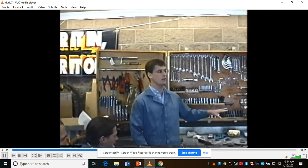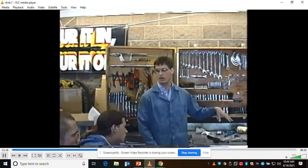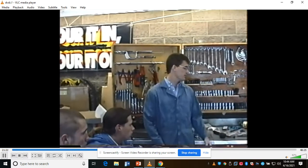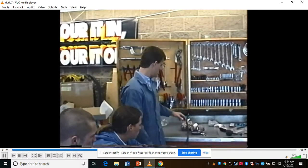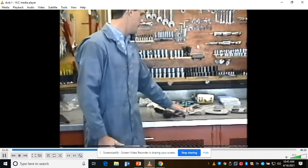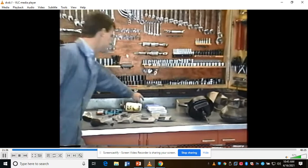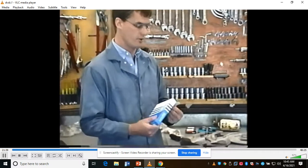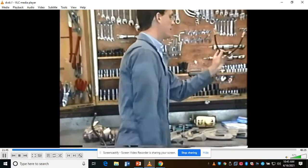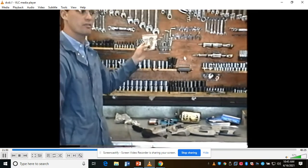This disc brake setup actually came factory equipped on a '69 to '74 Nova or '69 to '72 Chevelle, or actually any Buick, Olds or Pontiac car with power front disc brakes. If you buy all the stuff that you need in a junkyard, let's say everything was obviously used: calipers, the caliper mounting plates, the dust shield, the rotors, the power brake booster. Let's say you got these brake hoses here, off an old Nova or GTO or something like that. You got these brake hoses, all this stuff, and a proportioning valve. Now I'm using an adjustable one, but you got a factory one.